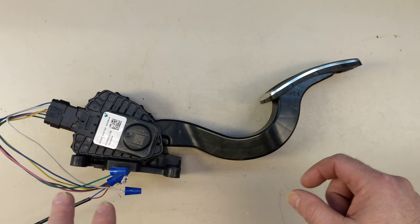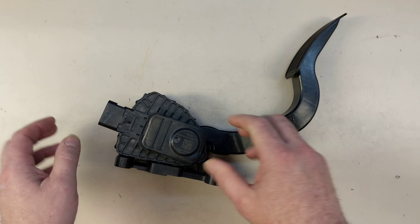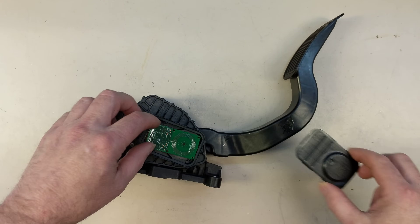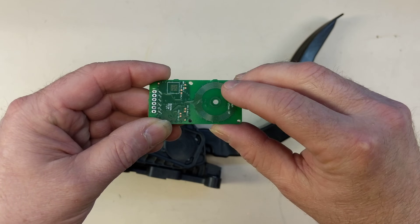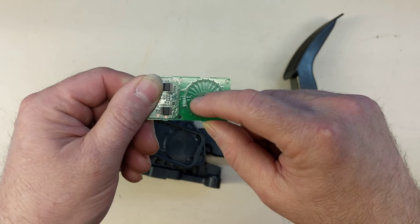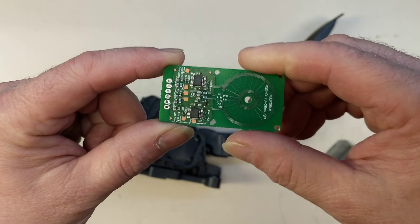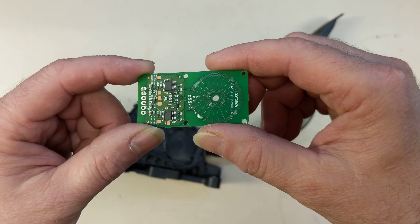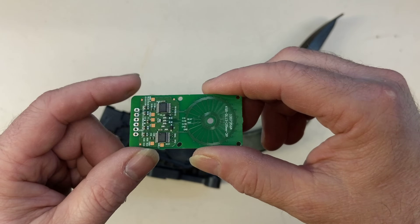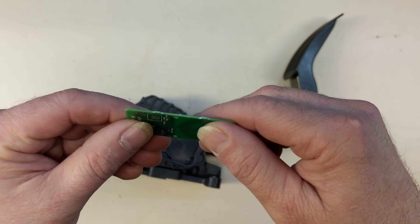So they now use a thing called inductive eddy current sensing. Here's one I've already taken apart. There's a cover on the side — you open that and it reveals a circuit board. The circuit board has a lot of strange traces on it on both sides: this one kind of looks like spokes in a wheel, and this is concentric rings. And then there's two chips on here. I tried to look up the numbers on these chips and they must be house-numbered — I'll put the number in the description if anyone wants to try, but I didn't have any luck finding these particular ones. A number of manufacturers make chips that do this.